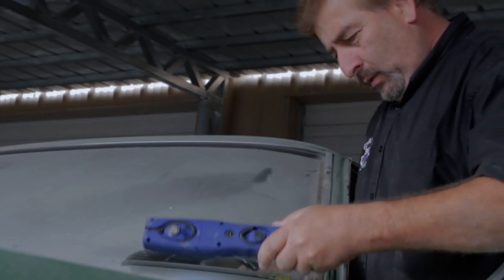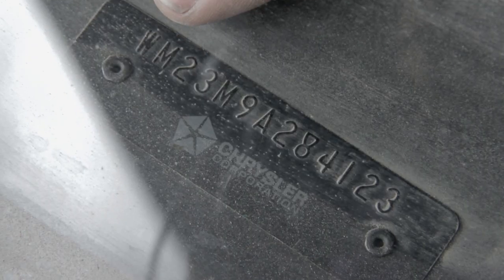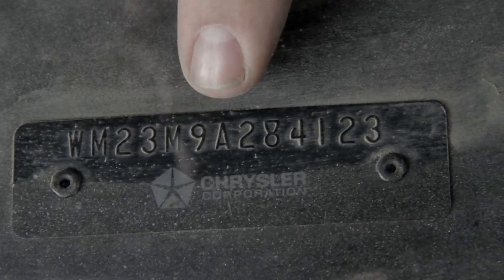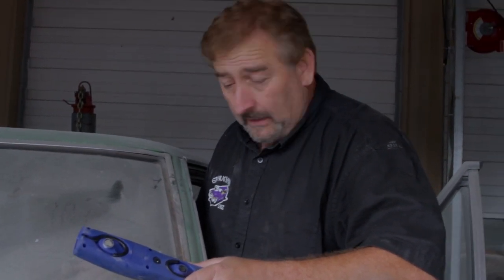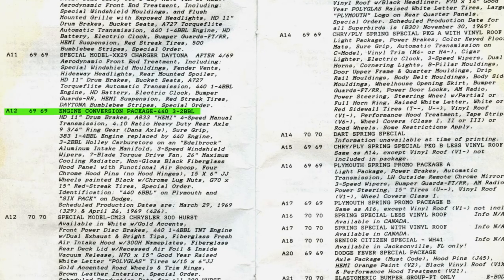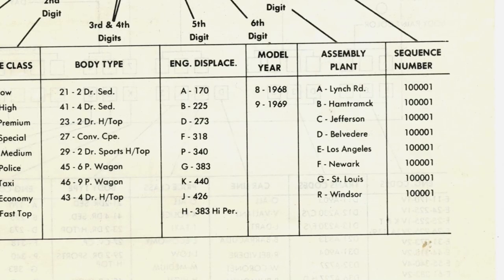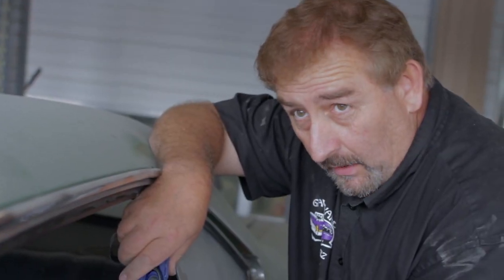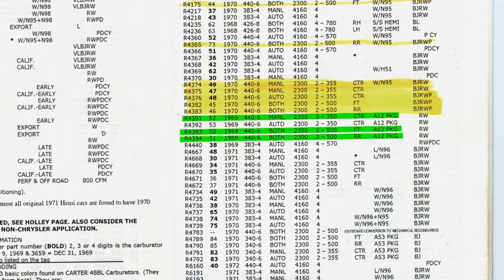We got a WM23M — M as in Michael — meaning it's a modified engine application. All 69 Dodge Super Bees started life as a 383; that was the minimum factory engine. If the car was destined to be one of the 69 and a half M-code spring cars like this one, they changed the callout from the 383 Magnum and made an M for modified. Then you've got 9 for the year and A for Lynch Road — they were all built at Lynch Road. We discussed the carburetors at length; we had the original correct carburetors and just needed Scott Smith at Harms to do a complete restoration on them.